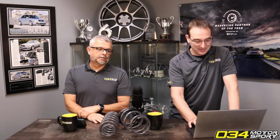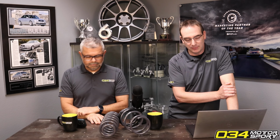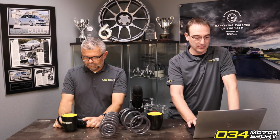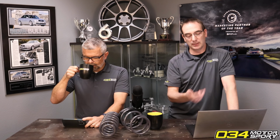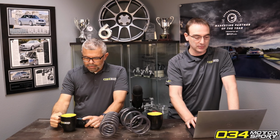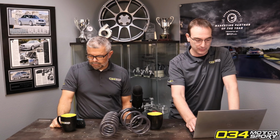Other than that, you could do a basic health check, but there's some things. If your coolant pump has never been done, that's one of those things that kind of goes out on all of them, depending on year, and I don't know what year vehicle this is, but there's an actuator in the pump that can start leaking coolant into the vacuum lines that control the ICE solenoid. So that's one of the non-standard things that this platform's kind of known for.